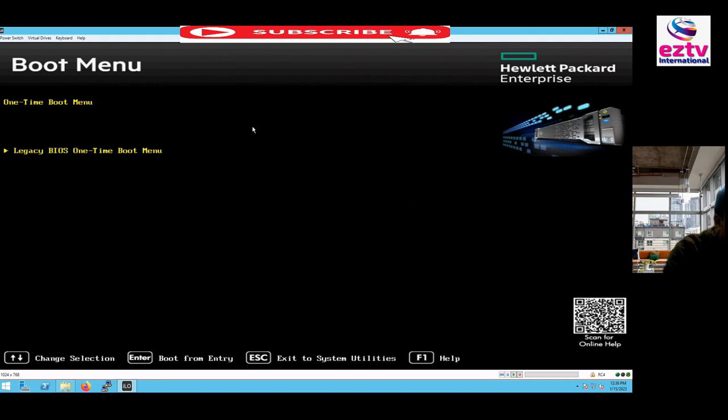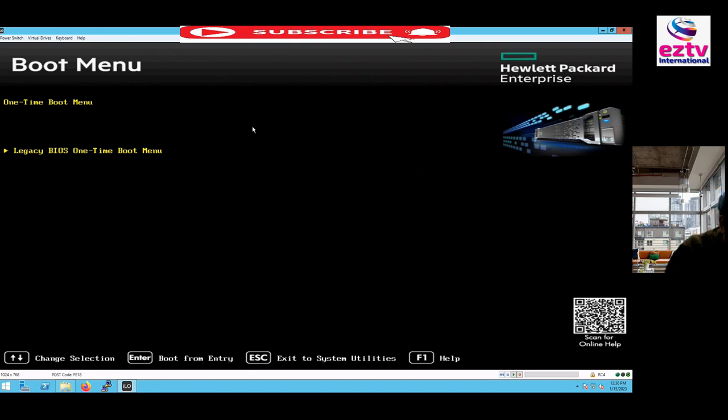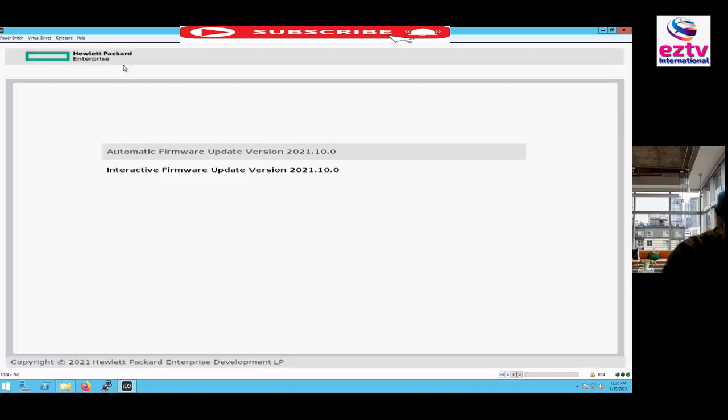In here, you're going to hit Enter two times. I hit Enter two times. And then you're going to see another menu. So number one, one-time boot to CD-ROM. I already attached the CD-ROM here. See, it's a virtual CD. That's why I hit the first one, number one. Now it's going to boot from the CD, from the service pack.